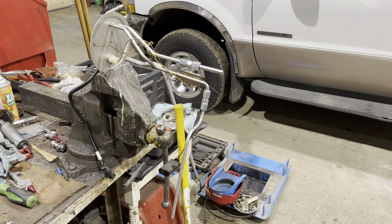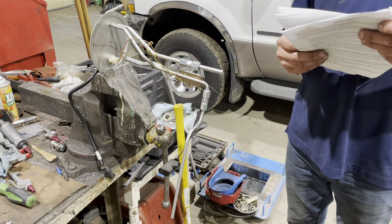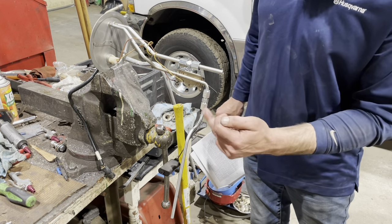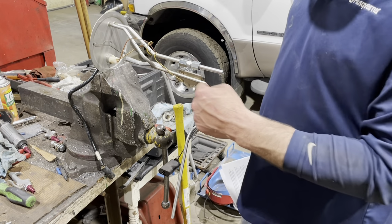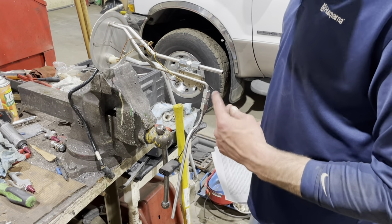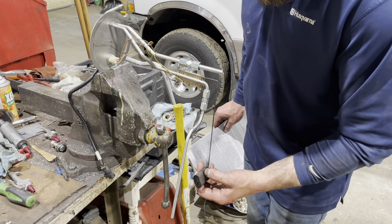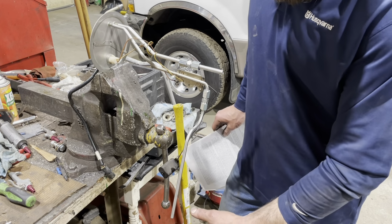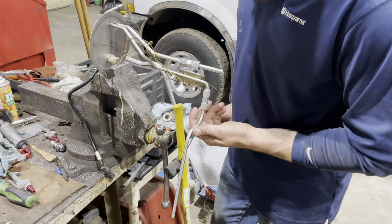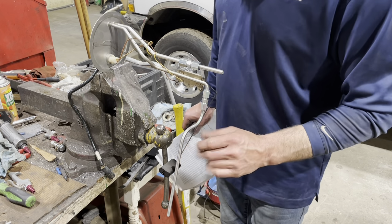All right. So we were instructed to put part number TK-05290-12-HBUS, that's this curved piece, can only fit on the return. So assuming what it does is it redirects the fuel away so there's no cavitation inside near the pickup. But this piece is bent and we gotta make sure we clear the sending unit, and we don't want it turned down too much to where it's going to hit the bottom of the tank or go lower than where the pickup is. So I'm gonna do exactly 90 here, straight down to there.